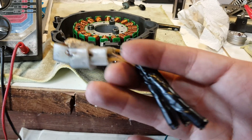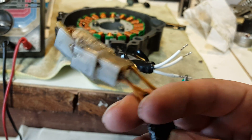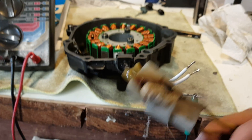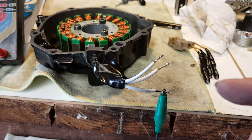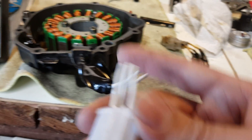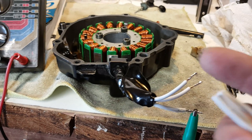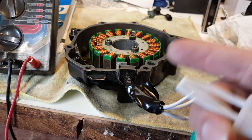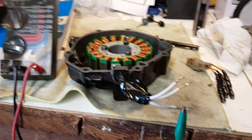Well, today I'm finally going to do that, for this very reason — that's pretty messed up. As you can see, I had it taped up before because I had actually cut this connector off a junk harness I had here in the garage. So we're going to go ahead and get rid of this today and just straight hardwire it in. I snipped off my connector off my brand new stator. There wasn't really an issue with my other stator, but I was getting inconsistent readings, so since I had a spare one laying around the garage, I thought I'd hook it up anyway — just to eliminate all issues.